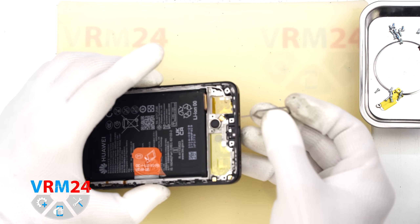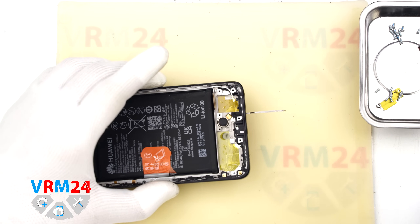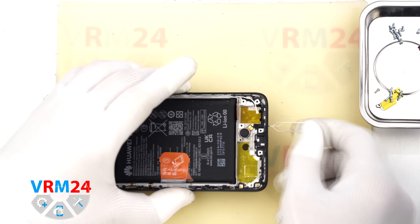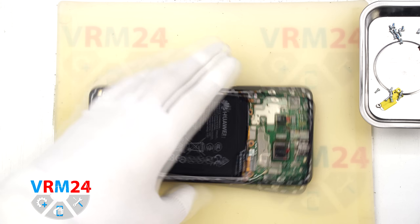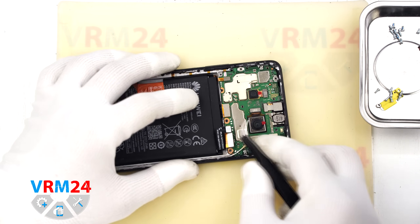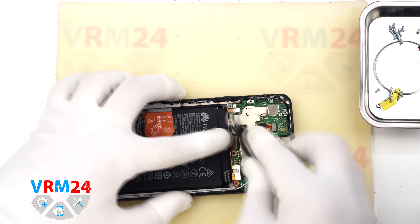Now for a quick test of the microphone opening. The microphone hole has an L shape — it is located in the display frame and is protected from the inside by a gasket. The microphone itself is placed on the subboard behind the hole. This means that if you insert anything into the mic hole in the frame, you won't be able to damage the actual microphone.